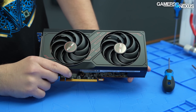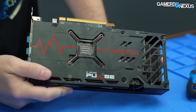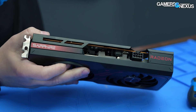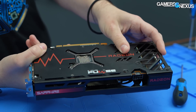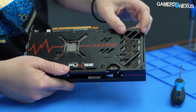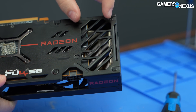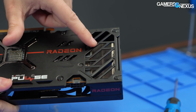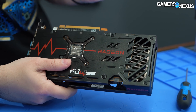So here's the Pulse. The RX 7600 cards start at $300. The partner models will be all over the place, but they start at $300 — this one probably will be a little bit higher, though we don't know the price right now. For the design, pretty straightforward. They're using a plastic shroud for the entirety of the card, except the backplate, which is a metal backplate, and that's a good thing. They're going with a partial flow-through area — the heatsink overhangs the PCB by about two inches — pushing air straight through the back of the card with very large spacing in the grill. It's good that there's not a ton of resistance there.